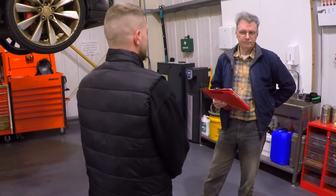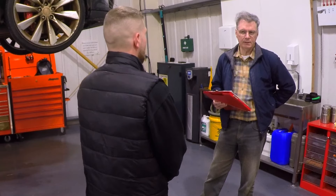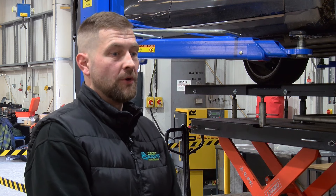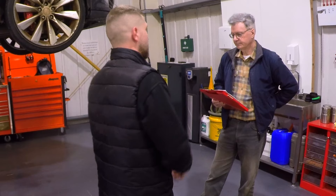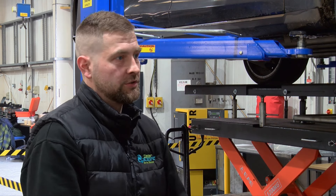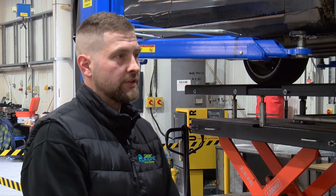You've done quite a few Nissan Leaf battery swaps and reconditions? Yes, quite a few Nissans. They have quite short lives because they can't get rid of heat very well. The Nissan Leaf doesn't have any thermal management in the battery pack itself, and the rear stack modules are stacked vertically. The modules in the middle get heated from both sides from neighbouring modules and can't lose that heat effectively — without being able to control its environment, degradation sets in.